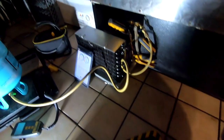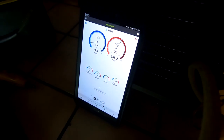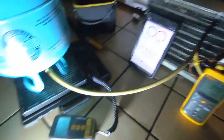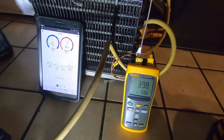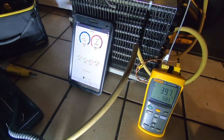Got our thermistor down here for the condenser. We're at about 67 degrees in the room, running about 105°F condensing, so we're right in there where we need to be. At about six ounces — this one holds 6.75 ounces — so we're just a little shy of the six-ounce mark. About 30 over ambient, running about 10 pounds suction.